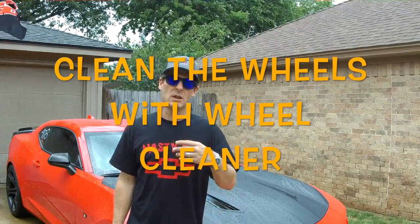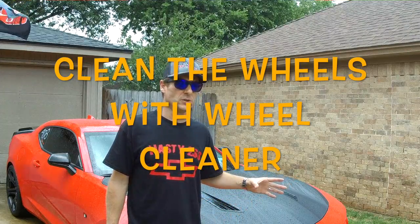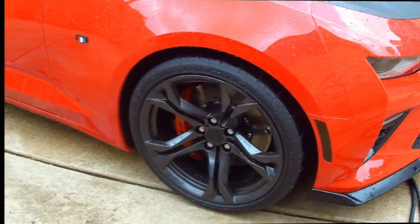Now that we've got her all sprayed off, the next step is to clean our wheels. Use a wheel cleaner and let it soak. After you get done with all four wheels, come back to the first one. I would say let it sit for 4 or 5 minutes after you get done with that last wheel, and then come back and start rinsing off the first wheel.